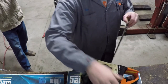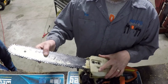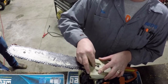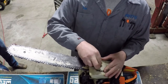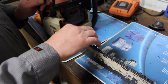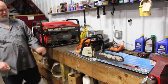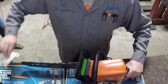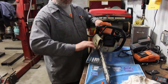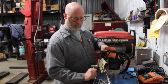Put that back on. There's a wrong way and a right way to put that chain on — you can put it on backwards. I've seen it happen; they don't cut that good that way. Always at the top of the chain, cutter edge away from you. Don't grab the chain with your hands — make sure it spins. Always use a shop cloth or a leather glove. Check your chain adjustment — everything seems good. Don't need a thousand pounds of torque on these; tighten them down and you're good to go.